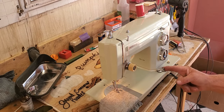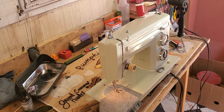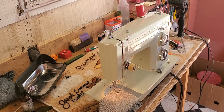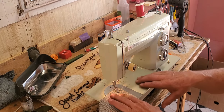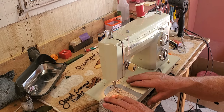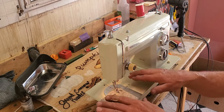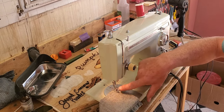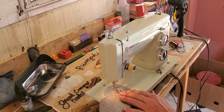This is your feed drop. This is what drops the teeth of the feed dogs that move the fabric. And when this is in the down position, the teeth don't come up above the needle plate, so they don't touch the fabric and don't move the fabric. And that's what you're going to use if you want to do free motion sewing or maybe some mending or machine embroidery or just art. If you want to draw pictures, you would drop the feed there.